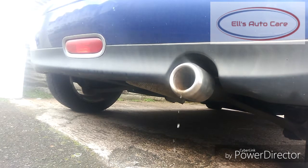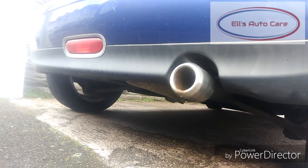At this point, look for leaks. If you haven't got any, just leave it idle for a bit. If it doesn't cut out, then you know that there's no air left in the system. If it does, then you probably need to reprime it.